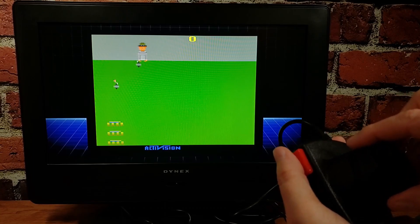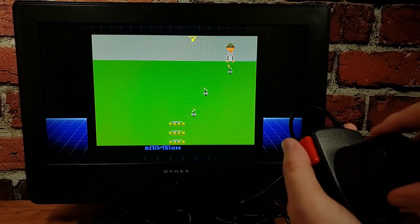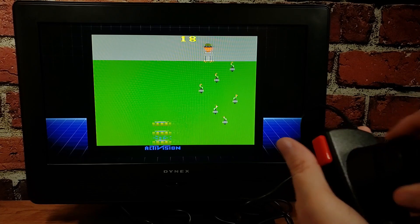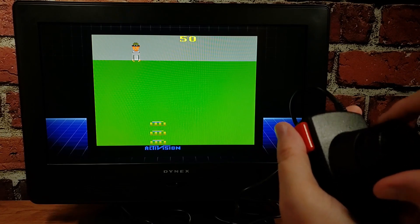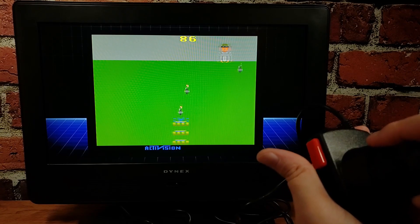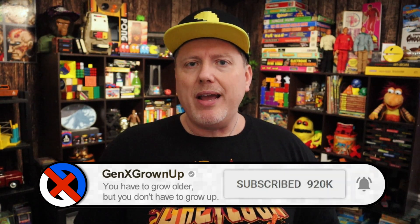In this video, what I hope to do is put something quantifiable around the weird feeling I experience with this paddle control. A lot of commenters have reported — and I've experienced myself — that control across the screen with the paddle does not feel smooth, consistent, and uniform. Ideally, as you turn the knob, whatever you're moving across the screen — whether it's a paddle in Breakout or catching bombs in Kaboom — should move perfectly in relation to how far you're turning the paddle. I wanted to accurately measure how far I turn the paddle and how far the object on screen moves.